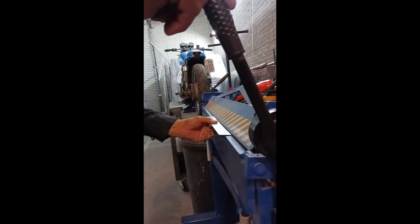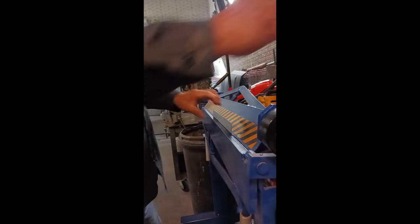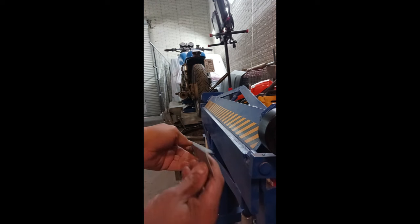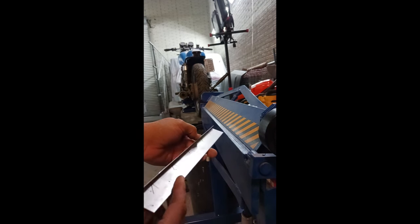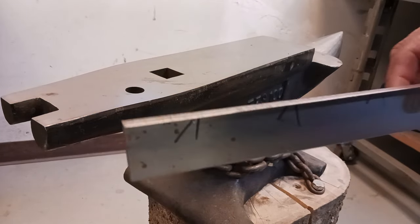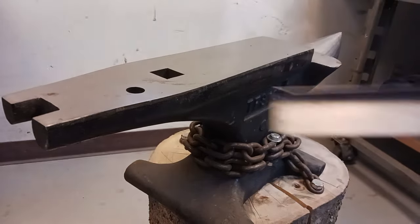Let's get back on track. We've got our sheet metal cut out to fabricate that piece and put it in the brake. Now we have our flange, and I've over-rotated that slightly — here's a good shot of it, it's slightly past 90 degrees. That's not an issue.